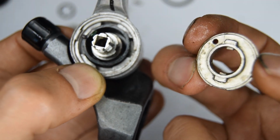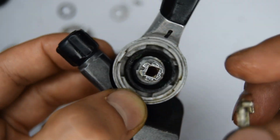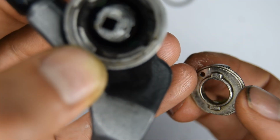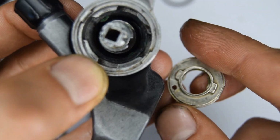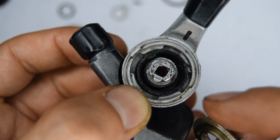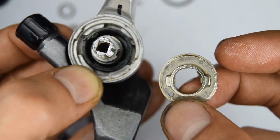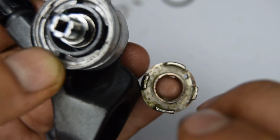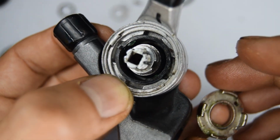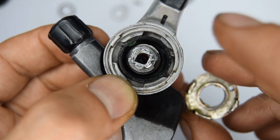Now we're going to need to tension up that spring, and at the same time we're going to need to engage the teeth into the correct position with this top plate. So the other tip of the spring, I'm trying to capture it on light there, it's going to go into that hole, and you'll notice that in the center here, the hole of this plate, there's two teeth on both sides. Those two teeth are going to need to engage onto the holes here and here, and you'll also notice there's another further 4 teeth underneath: two large and smaller ones. So the two large ones need to go here, left and right, and then the smaller ones on the top.